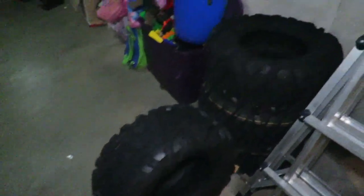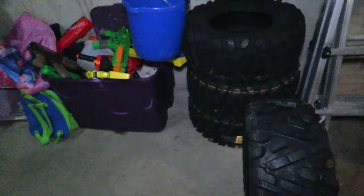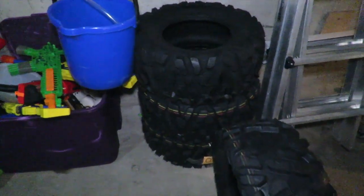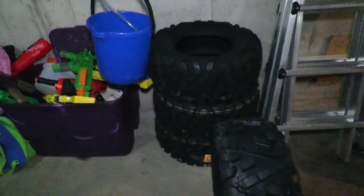That was an area where you had to go a long ways just to get on any trails — not the case with these ones. I live somewhere else now and these won't see too much road use at all. I put 25x10-12s all the way around, which protects the front rims and they look a lot better having all the same size. I've had all the same size 25x10-12s front and back — never had a problem.